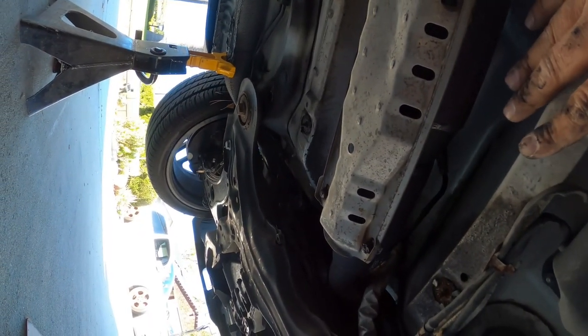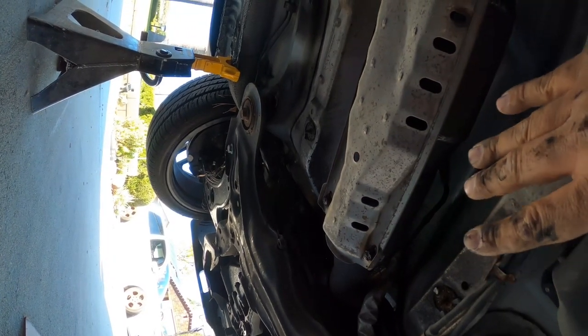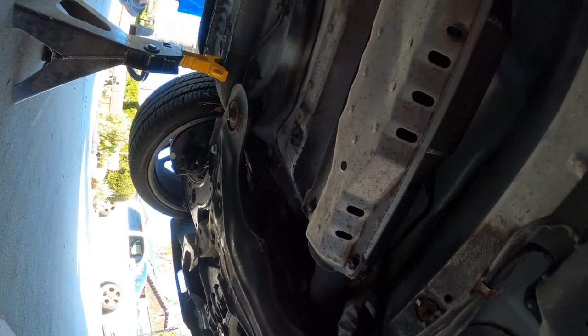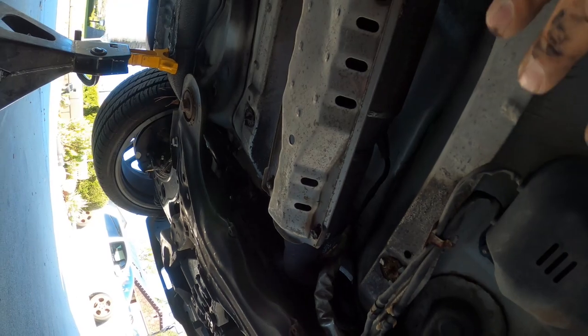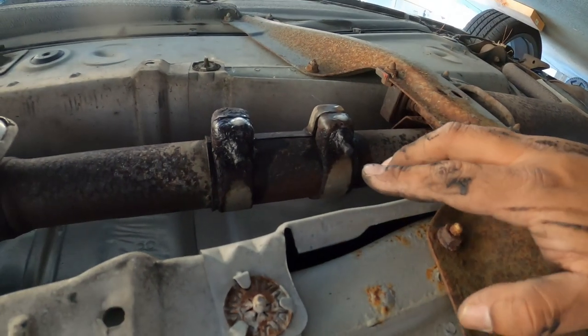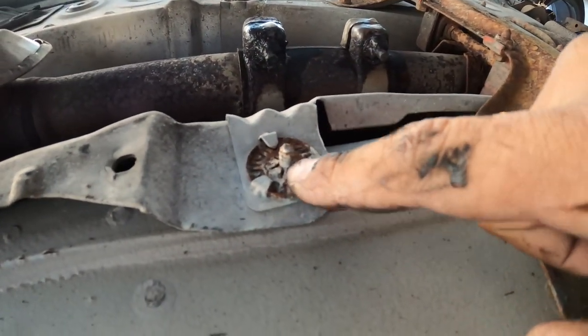There's two of them, one obviously pre-cat, and then, actually this car's a little different, but there's a pre, and then here's the one right before the cat. So there you go. Let's see here. So there are four bolts underneath the downpipe for the stock downpipe, two right here for the sleeve, and then these little guys are annoying.